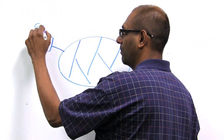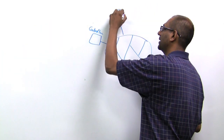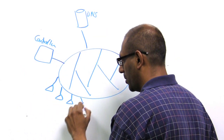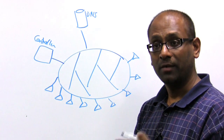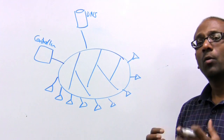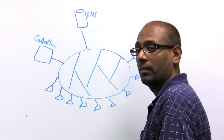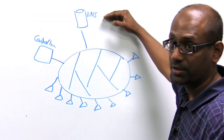Go ahead and put yourself a controller. If you choose, you could set the controller IP address to a name and map that to DNS. Then sprinkle around access points. In this video, all I want to discuss is how quickly the system can be set up as plug-and-play. Step one: you plug in a controller with one port, give it an IP address, and optionally map that IP address and name to DNS.